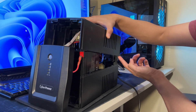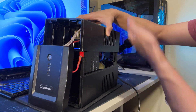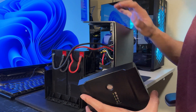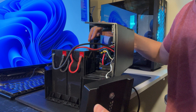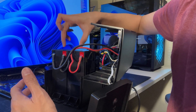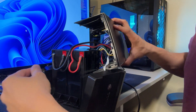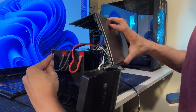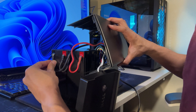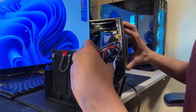There's a guide rail here to guide the panel sliding up and down - take note of that. Also, you wouldn't want to touch any of the open wires at the back where the transformer is, especially if the battery is still connected, as it may still hold a charge that could electrocute you. There's a bit of corrosion there, but that's normal and not really causing the problem.